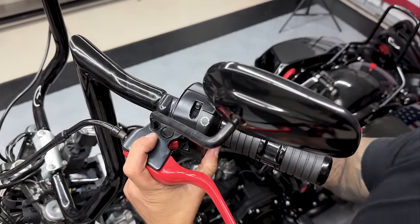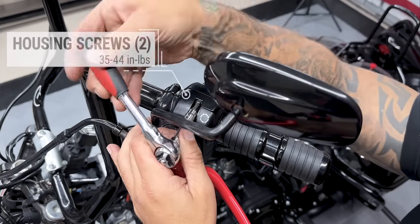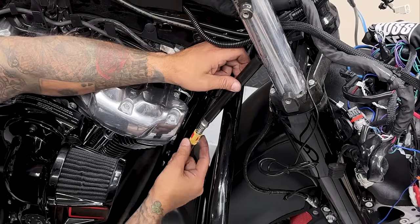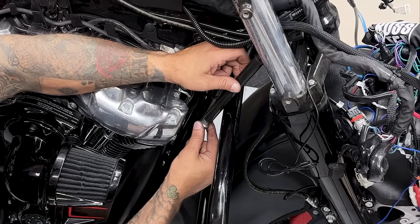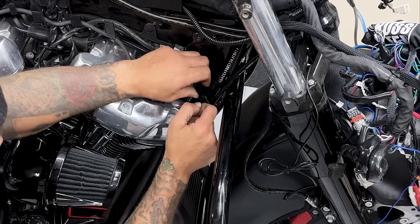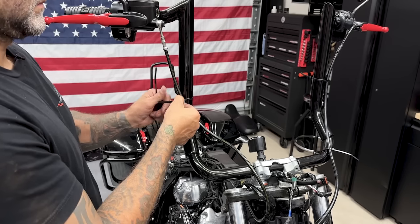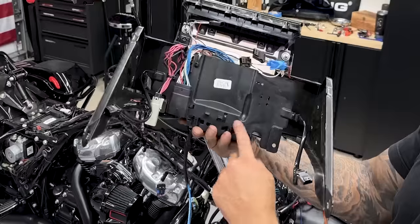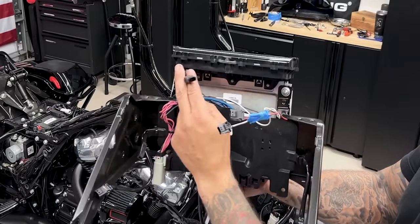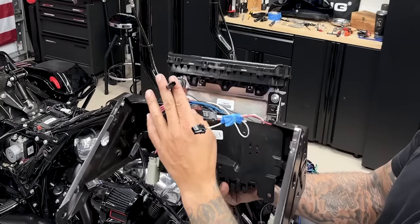Cut off the old bracket — it won't fit around the inch-and-a-half bar anyway. Now get the clutch side installed. You don't have to worry about rerouting this one — we added the clutch line extension, which gives plenty of line. The clutch is still very loose, so we'll get down to the clutch adjuster to get this adjusted. Pop the red locking tab out and adjust the clutch up or down — now it engages like it should. Get the sleeve back on and get the clips remounted. Zip tie the brake line and clutch line to the bar — route the lines in front of the bar so it's cleaner on the back. Your switch harnesses are located right here: run/stop switch along with the right handlebar switch harness, and the left handlebar switch harness. Get these connected.